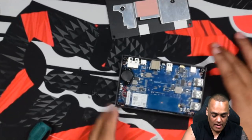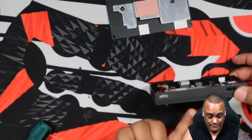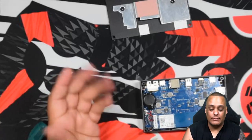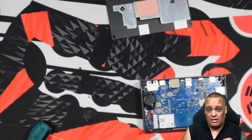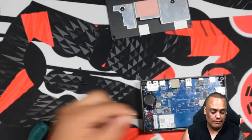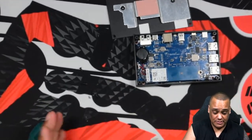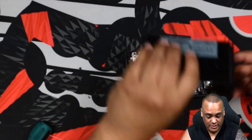A 512 gigabyte M.2 costs around $60–$70, and a one terabyte is about $90–$100, so they're not that expensive anymore. Unfortunately the RAM is not upgradeable — it's soldered. Also visible inside is the CMOS battery with its connector — to reset the BIOS you just unplug it and plug it back in. To close everything up, just reverse the process and put the four screws back in.